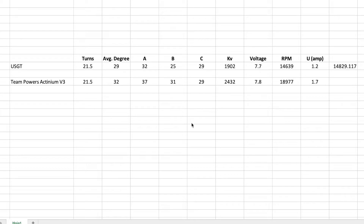It only draws 1.2 amps, so it's a very efficient motor in terms of amp consumption. Your battery is going to last quite a while, meaning you can probably get away with a lighter pack. Anything drawing below about three amps isn't going to draw much. Keep in mind the point of this comparison is not to say the USGT motor is better or worse — in USGT class everybody would be running this motor anyway. The main thing to compare would be how far off individual USGT motors are from each other. The fixed timing at 29 degrees, close to the spec 30, is a positive sign.